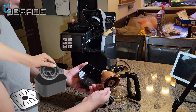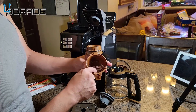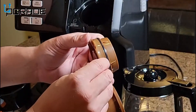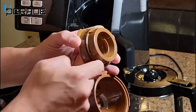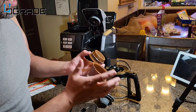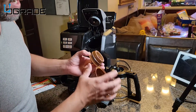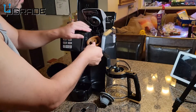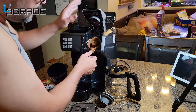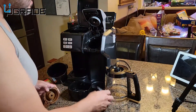On this part, they have the actual brew system — you don't need a K-cup, you could just put your own coffee in here. There are already filters in here and it's replaceable. When you wash this, it's very important to remove this rubber gasket ring and clean it, because this gets a lot of fungus if you don't. You can even replace these rubber bands. A lot of people don't know this — you've got to remove the rubber band, wash it, because fungus will grow in there. Once cleaned, just screw it back in. This is for regular ground coffee, not instant.